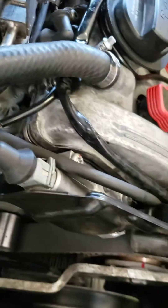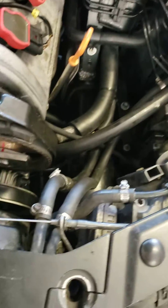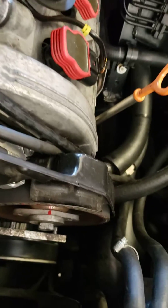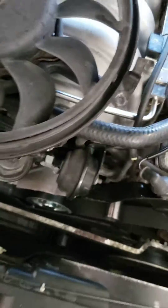You advance the timing — you turn it clockwise, so you lift the bar up. And now it's at one, and the other side's at zero. This other one was reading incorrectly and I had to move it forward as well. I think something shifted on the sprockets on some of these, because this bar clearly will not — it hits the other sprocket. But the timing's great.